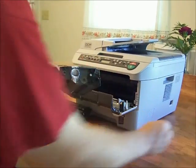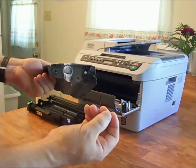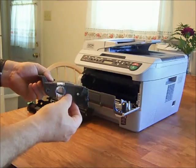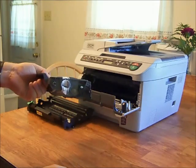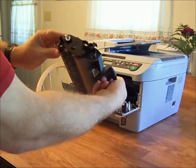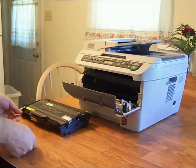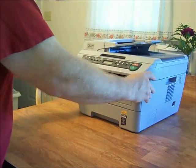So all I'm going to do is take a little piece of putty — now this is a piece of modeling clay, it's like an oil-based clay. You can use really anything. You just want to plug that hole up there. I've seen other people do the same thing with masking tape. Now the masking tape is partly see-through, so if you do masking tape, you want to double it up or triple it up and even possibly put a piece on the other side too. But using the putty, all you need to do is the one side — put it back in, put the cartridge back in, close it up.